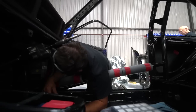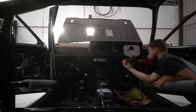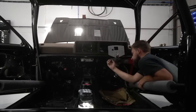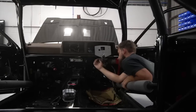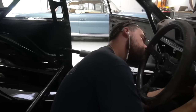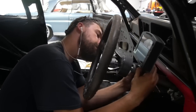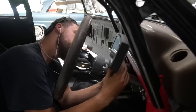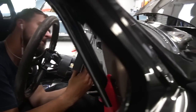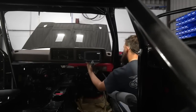So what we do on this one, and we've done it on another car before where we got rid of the stalks, is make a complete new tube for the upper column, machine a little bearing housing that's welded into the end of it with an internal circlip groove, so we can circlip a bearing into the top there, and also incorporate the mount that bolts it to the dash into that. So it's just a completely clean unit, with no complicated unnecessary OEM parts, and we also weld the mount onto the top of that for the digital display.